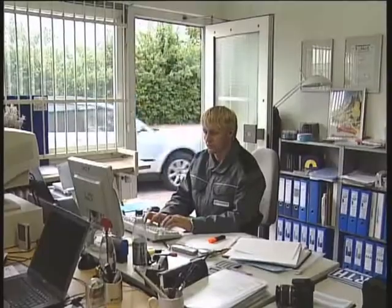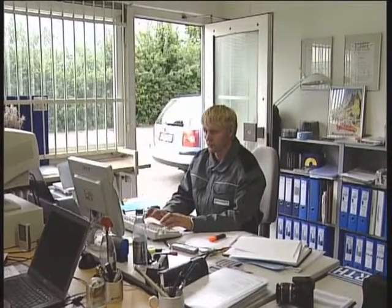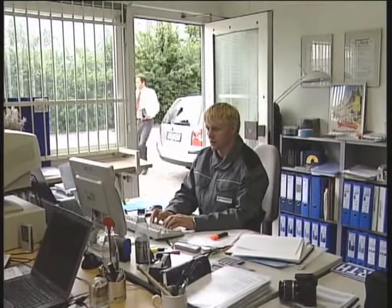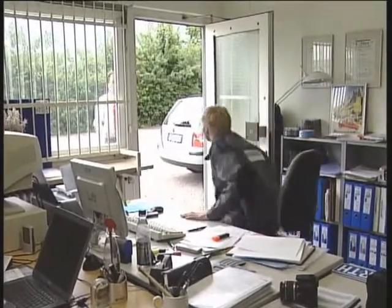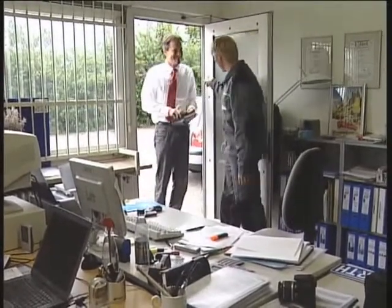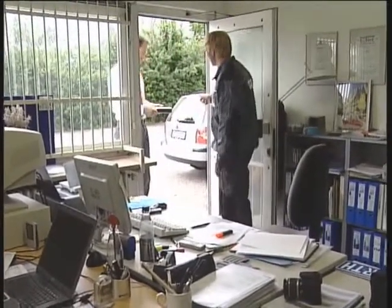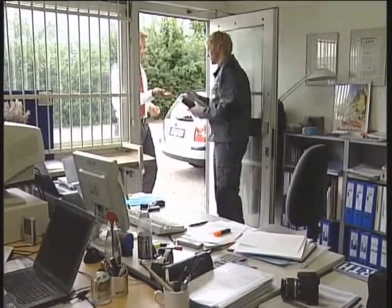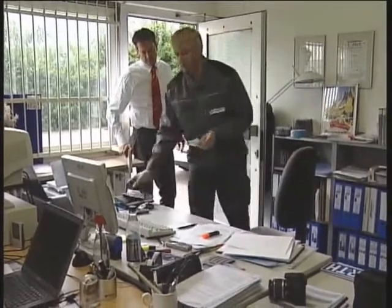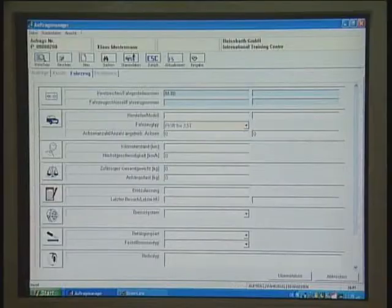Pipelining. Another extension of the BNet strategy is upgrading the SL680 test lane into a test station where the exhaust gas test can be carried out and the headlights aligned. It all starts off with the inspection, and all tests to be carried out will be recorded in the order manager. This may also be imported via the ASA gateway if the relevant order processing system exists.